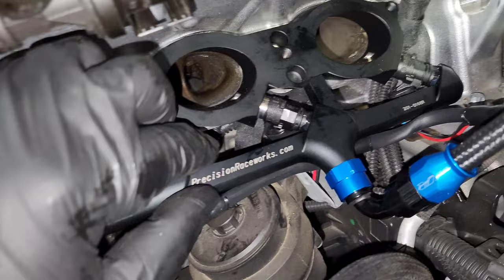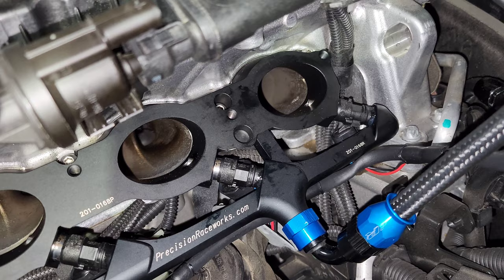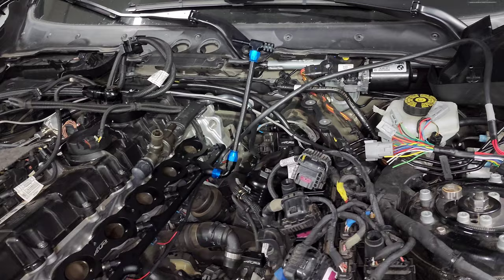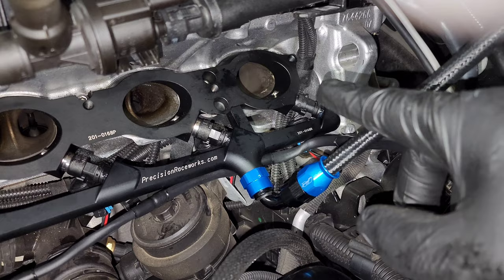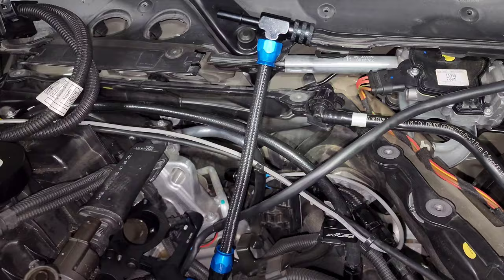With the port injection plate in, use a 4mm Allen and the provided screws to bolt it to the cylinder head. You may need to rotate some injectors - for example, the one by cylinder five needed rotation because the water pump is right there and it was hitting when pointed straight down. Rotating injectors within the housing won't negatively impact anything, so adjust as needed for clearance. The standoff should be pointed straight to the right since that's where the intake manifold will be relocated - up and towards the right side of the car. Also make sure the wiring harness is tucked behind injector six before reinstalling everything.